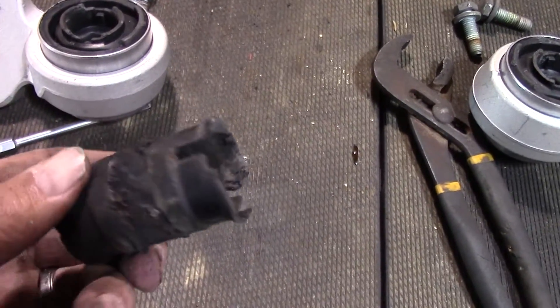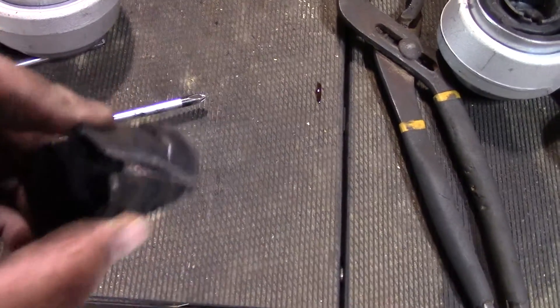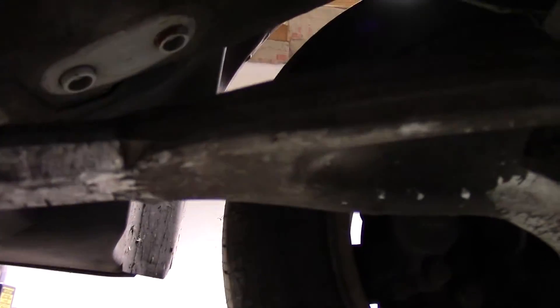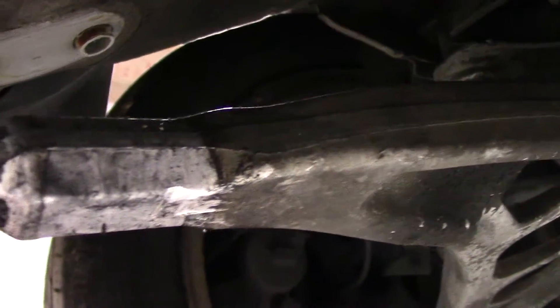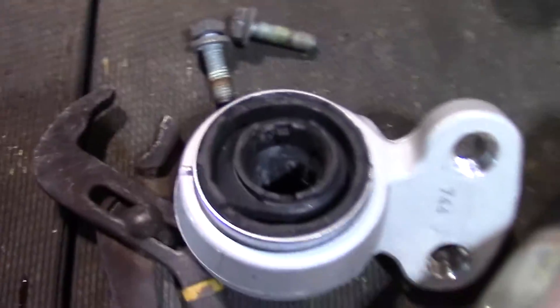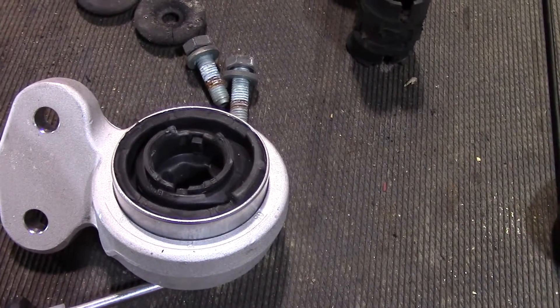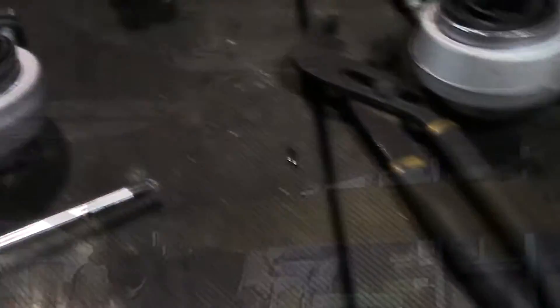In a situation like that, you have to take a sawzall and very, very gently just split that bushing. There's a metal sleeve around it to get it to spread and come apart, and of course not damage the aluminum control arm. Now we have that off. We'll clean everything up and slap a little bit of lube in them to aid them going on easy, and then we'll go back together with it.